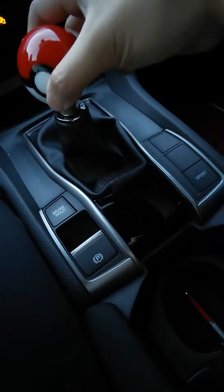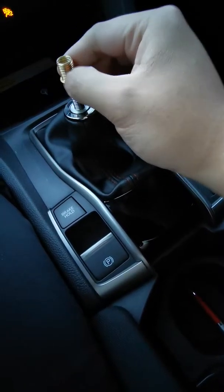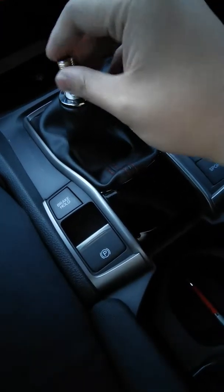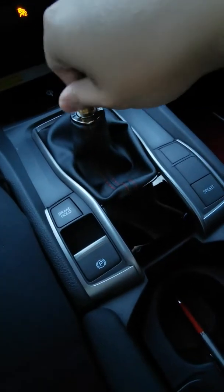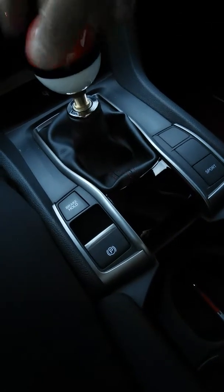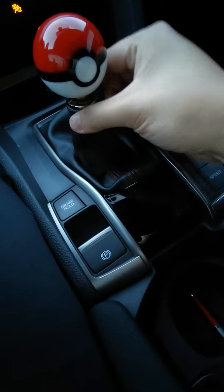This won't just lock onto the shift rod on its own — look at how loose it is. So what you need to do is install this little mounting adapter where it sits like so, then spin that on there. That way the shift knob can now screw onto that. Bring it all the way down so it doesn't move anywhere — it's locked into place. Now you can go ahead and bring this guy down, like so. It goes on like a pokeball and that's good.